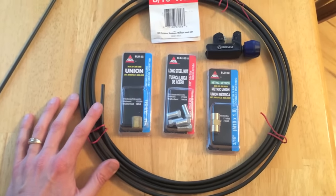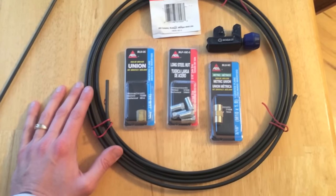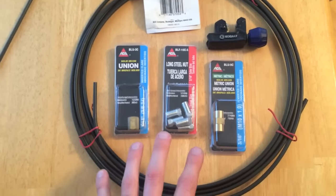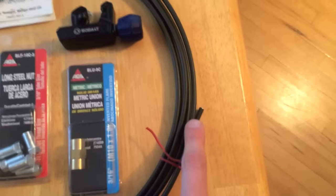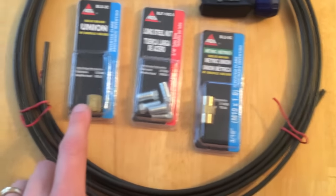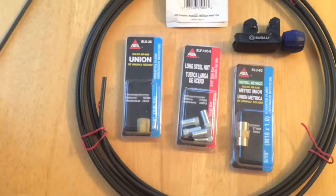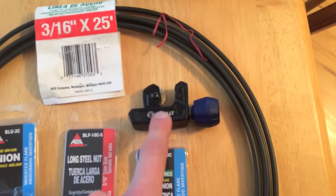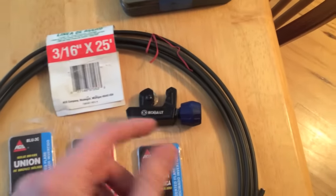If you get to it before it starts leaking, good; if you don't, you could run into some problems. A lot of people get the whole roll because it's the best bang for the buck. However, if you do get the roll, you do have to get a lot of miscellaneous accessory parts with it — for example, the steel nuts that you will put on the tips, and your union. If you've got a portion of your brake line that is rusted and you want to cut that portion out, you can use your cutting tool. Basically, all this does is you connect this on the actual line and spin it around, tighten it a little more, spin it more.